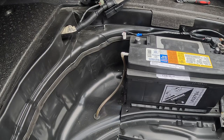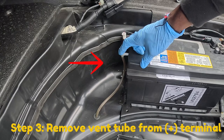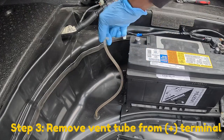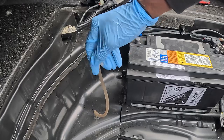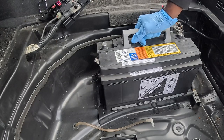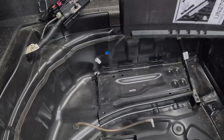The third step is to remove the vent tube that you see here. This vent tube is going to be on the positive side of the battery. Before you lift the battery out, do not lift it and yank this tube out — make sure you remove this tube first, and make sure you replace this tube back in the positive side of the battery when you install your new battery. Now we've gotten everything off — bolts and vent tube — so we're able to remove the battery.